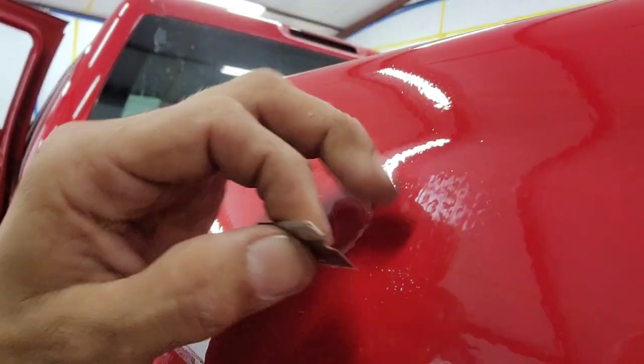Once you run the blade like that — which, like I said, is at your own risk — you can remove some of the dirt nibs. Other than that, just by sanding, especially if you're using an interface pad, it's just going to go over that bump — that dirt nib — just like a bump and leave it there. So I would say the Toe Cut is worth it. It's just small sanding blocks and it's a starter kit that comes with all different grits from 800 all the way to 3000. If your vehicle is already clean and you spot an imperfection, you don't need to sand the whole vehicle — you can just spot-sand that area, take it all the way down to K3000, and just polish by hand with a microfiber and a little dab of compound. You'll polish out that area like nothing ever happened.